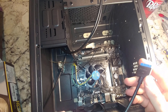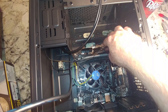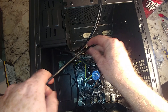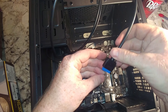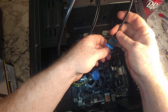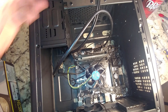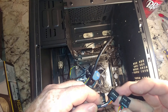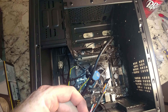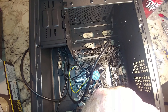We've got USB 3.0 from the case — let me locate where that goes on the motherboard. There's a little slot and a corresponding protrusion to ensure correct orientation. Now regular USB 2.0: there's a missing pin on the connector and a missing slot on the motherboard header — line those up and be careful not to bust them off. That's in.